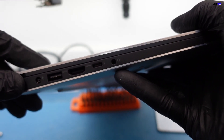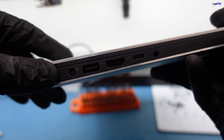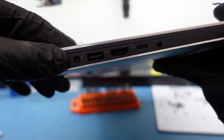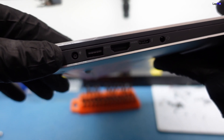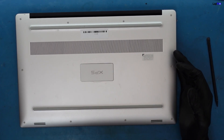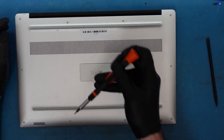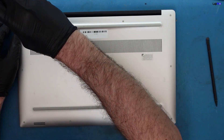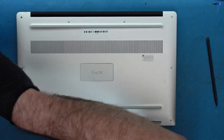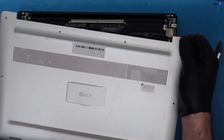For this laptop, it does look like the DC jack has been damaged, and what we're going to do is just replace it. Replacing this one is actually pretty easy, not too bad. I just want to show you guys what the different things may be. So let's go ahead and replace the jack — it doesn't take too long — and we'll make sure we test it out to make sure there are no other problems. We'll flip it to the bottom; you would need a Torx screwdriver for these, usually to prevent people from opening it in the first place.